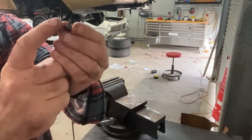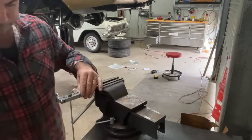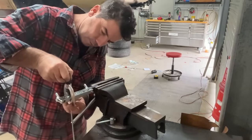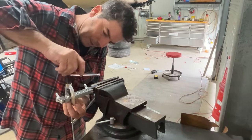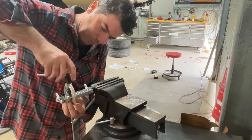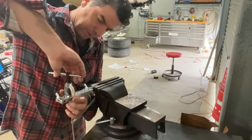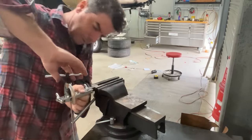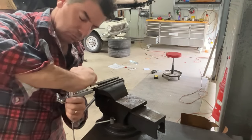And see, that's got a little top on it. That goes in the end of your pipe. And you get this little fella. And this is double flaring. So this is flaring that edge in first. Double flaring for high pressure like brake line. Single flaring's okay for, I don't know, low pressure stuff, whatever low pressure stuff might be. Low pressure fuel, maybe.